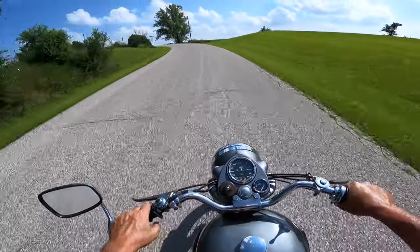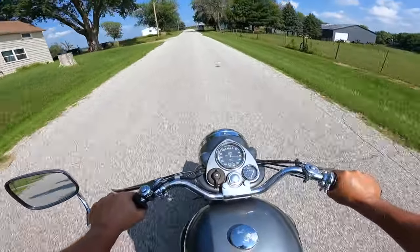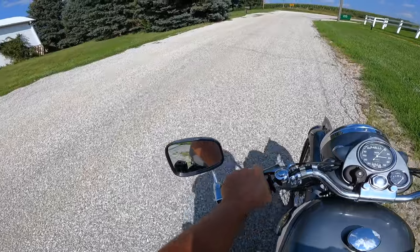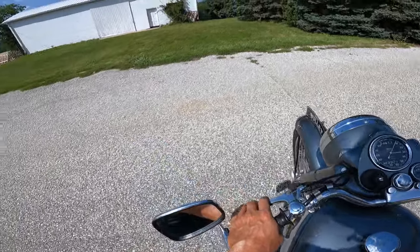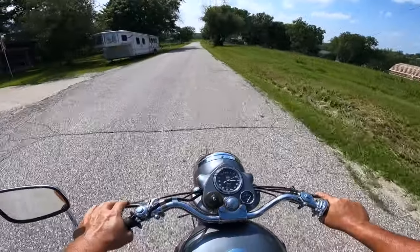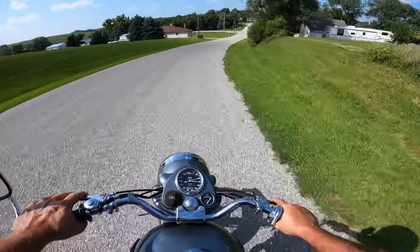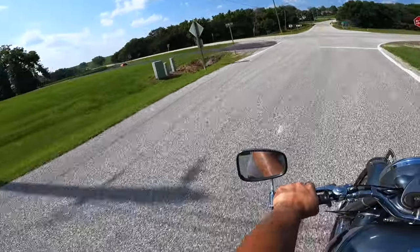I love it — look at that chronometric speedometer, it goes in increments. Shifting is an interesting thing: not only is it on the right side, but it's the opposite of normal. That must be neutral. Apparently I found another neutral! My understanding is that when you get going down the highway on this thing, it smooths right out. The front brake — I think it's a six-inch shoe, double-shoe, two thin shoes with two cables off the brake lever. The rear is a single brake shoe.